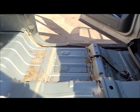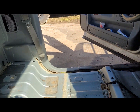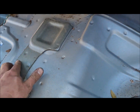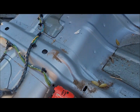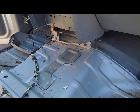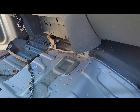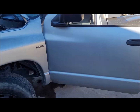Alright, I got the interior out. Luckily we're here in Texas — no salted roads, no snow — so this thing's super solid, as I expected. Here's the boot; it's got these hold-downs. I lined it up and it looks like it's going right here. These are where all the screw holes are. I'm about to cut this square out with the air tools — got the compressor going. Once I get this cut out I think I'm ready, though I still gotta put the clutch and stuff on, then I'll be ready to stab this trans and get it seated.